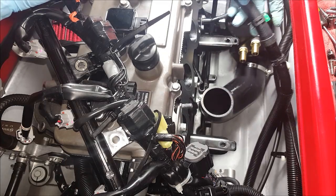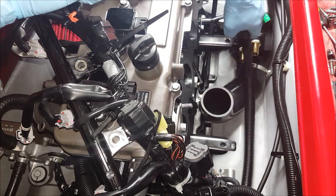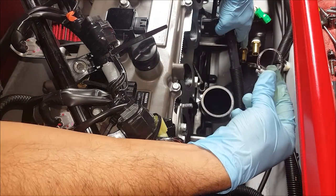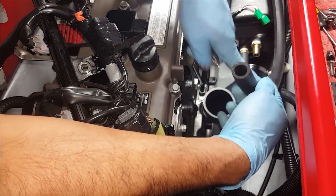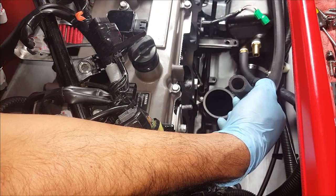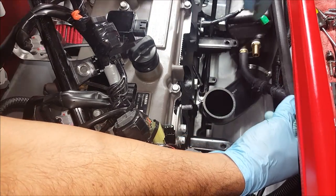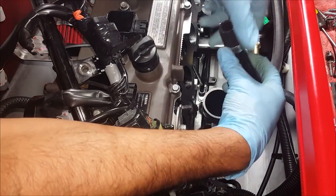We're going to install the cooling lines now. This is the input side, which is going to go on the lower barb, and install it using the included hose clamp. And then we can run our outlet line. This is the same one that we hooked up the Y connector to the top barb of the intercooler, and again using the supplied hose clamp.